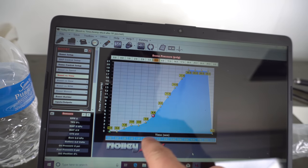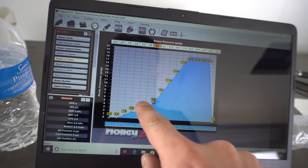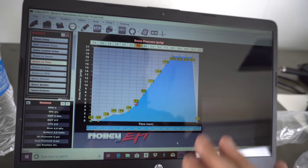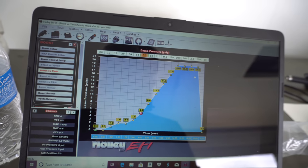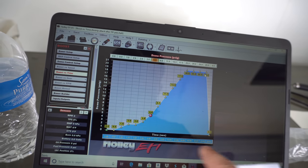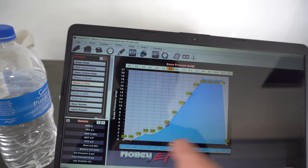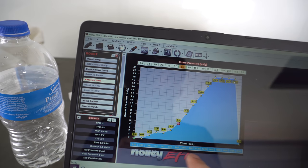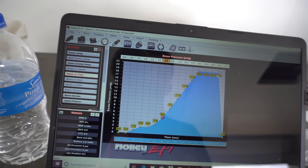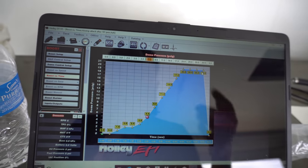So I need to smooth this out in that 4 second range, actually prior to, so 2 to 4 second range. Smooth that out, let it get a little more wheel speed, then add it back in and see what we do. I'm also going to look at the total time of the pass, so I can adjust my frames here to match what I'm trying to equal out at the backside, so it's not ramping in real hard or anything. I have it adjusting every 2 seconds, but I might need to start smoothing this out and then adding it later to get it to continue out.